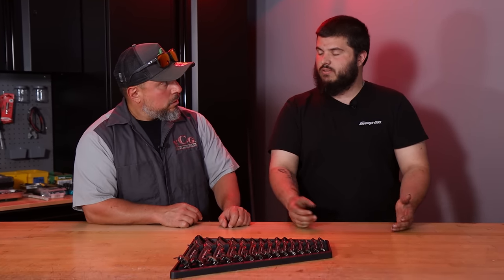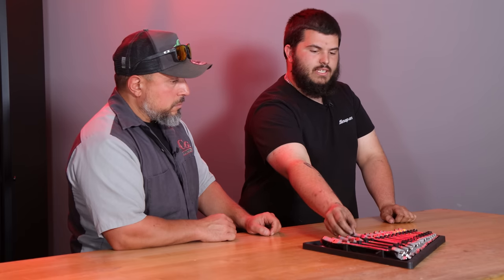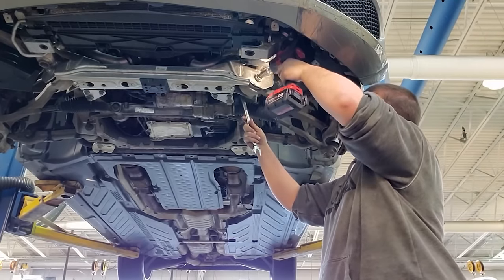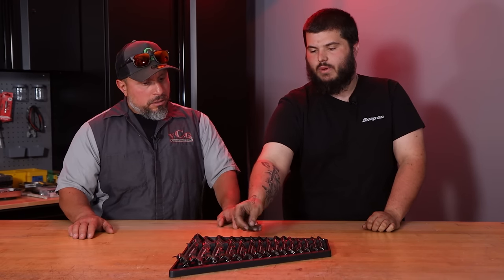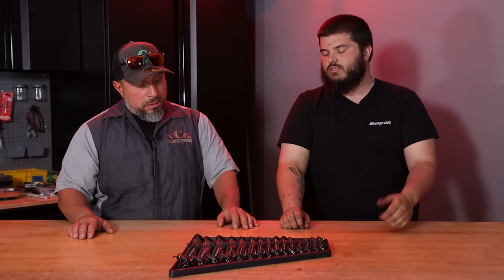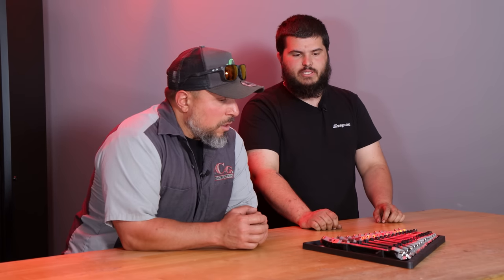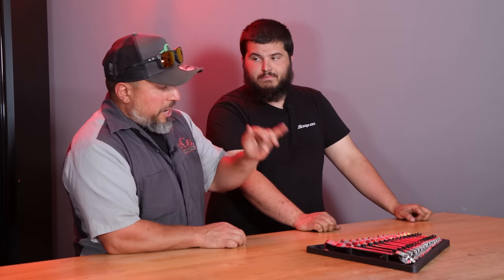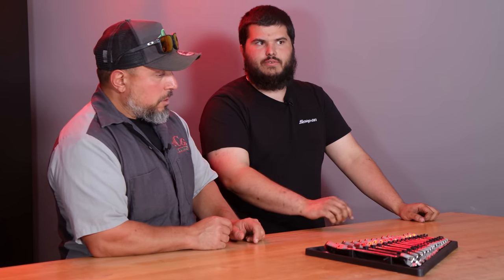There is a recall we have that involves replacing things on a steering rack. We have to take the racks down and that involves an 18. You've got to reach up kind of blindly, grab a nut, and then break it loose. Put the 18 up there, folded the box end out of the way, used the open end, grabbed the 18, and broke it loose. 21 for suspension work, 22 for suspension work. Is there anywhere these fell down? No. Compared to your Snap-on, you like these. I have reached for these faster than I reach for my Snap-on.